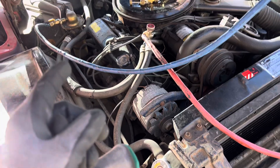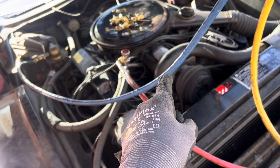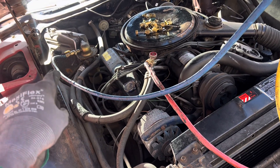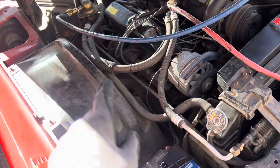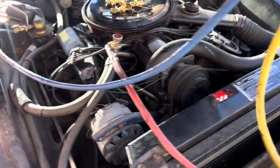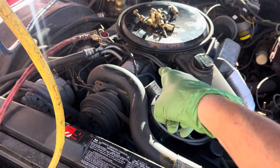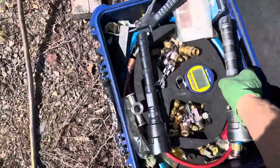That mineral oil makes compared to POE or PAG oil — how much moisture mineral oil does not absorb. It absorbs, but minuscule compared to POE. So they used a UV dye in here and I see the little oil stain, and I told them when these get old that crispy, crunchy O-ring at the back of the case of the head right there is going to be a leaker.